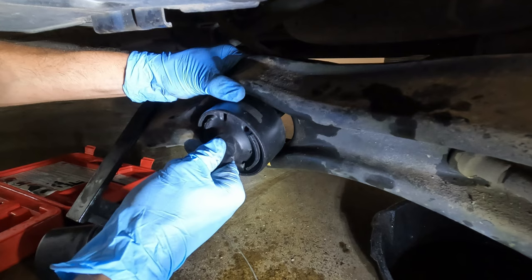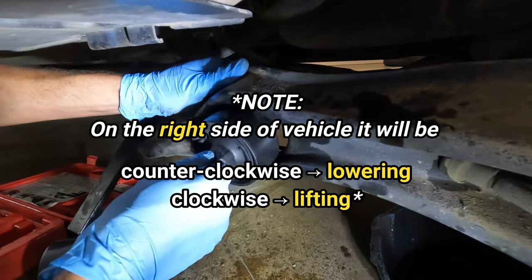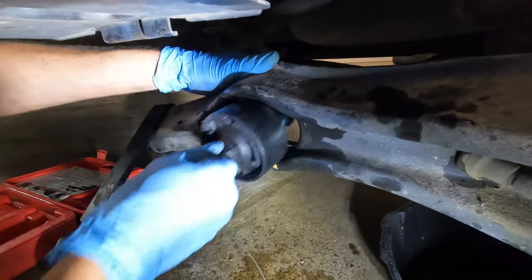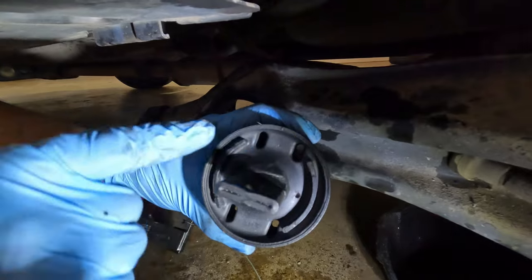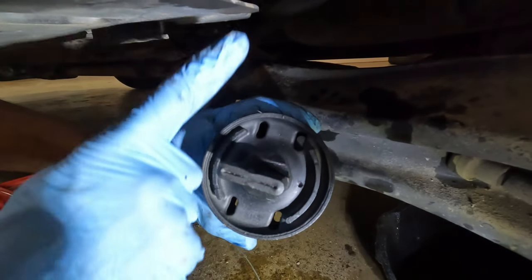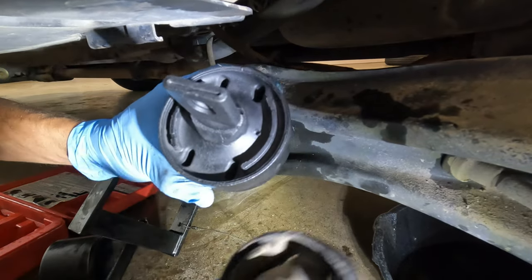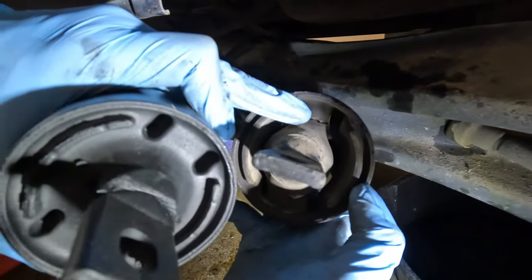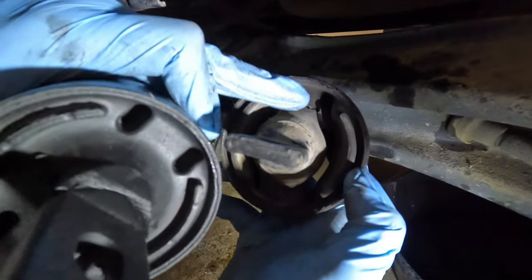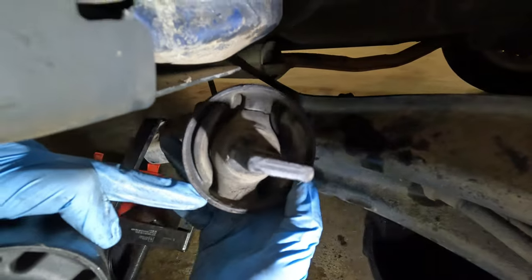If you want to lower your car, you're going to want to put it clockwise. If you're going to be lifting it, put it a little bit counterclockwise. Lastly, the part with the short space between the holes is going to face up; the long space is going to be down, just as in the stock bushing — when we took it out, this part was up with a small gap, and this part was down with a larger gap.